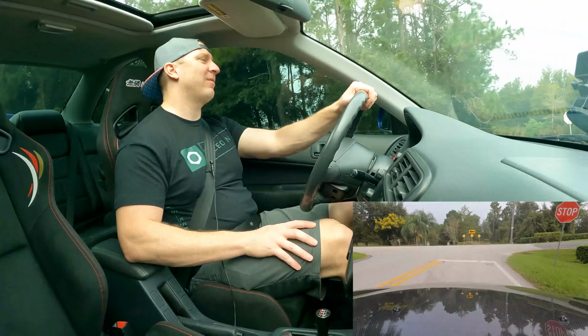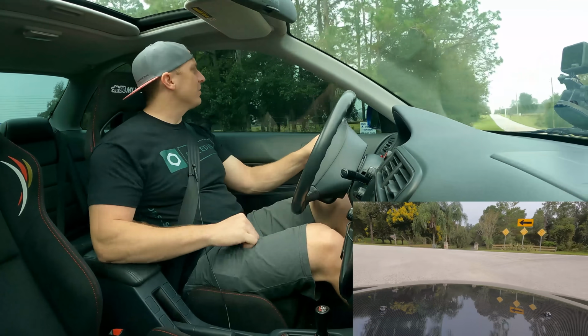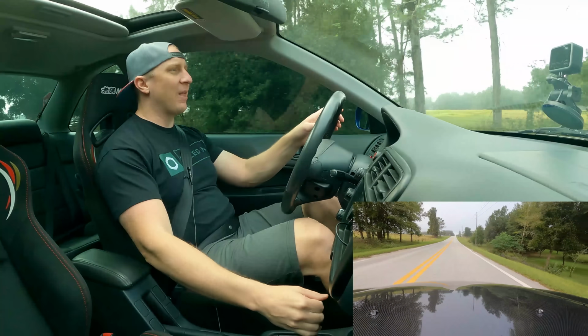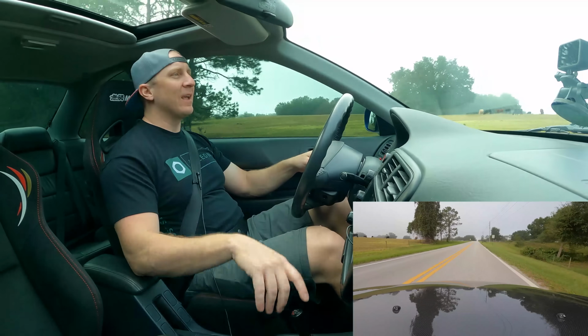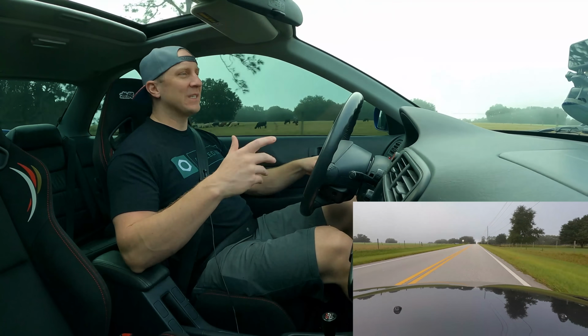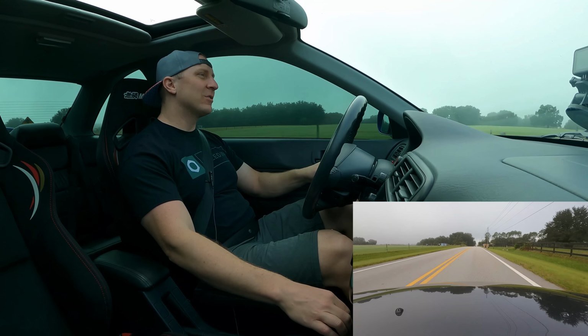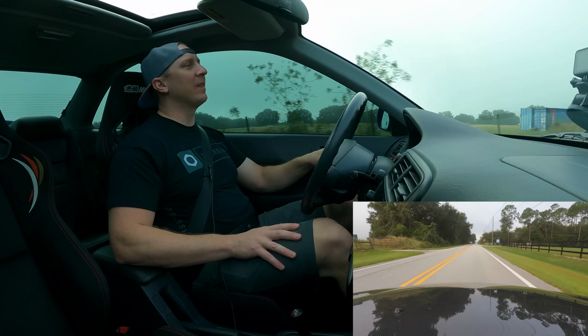Again, I just don't love the brakes. Now, apparently, I did some research. The spoon pads don't have a retaining clip in the spoon calipers, so the pads click and clunk a little bit under slow speed. I thought something was broken, or I was missing a retaining clip. So keep that in mind if you have one of these cars and you're planning on doing that.